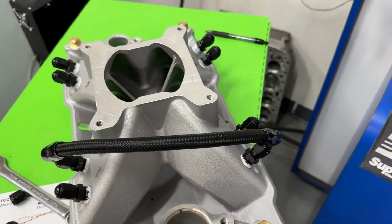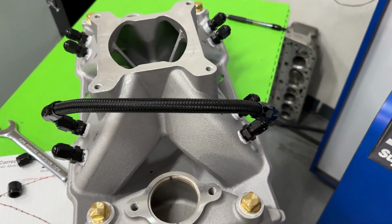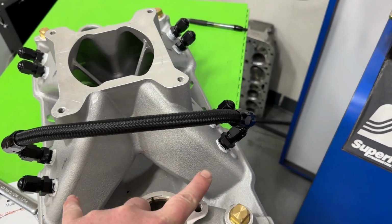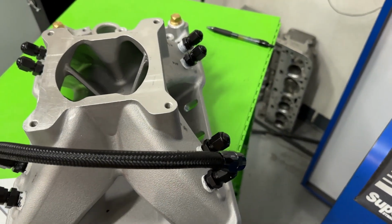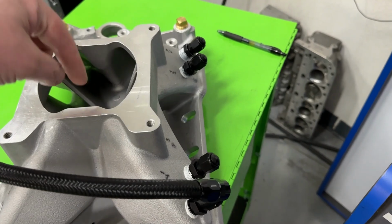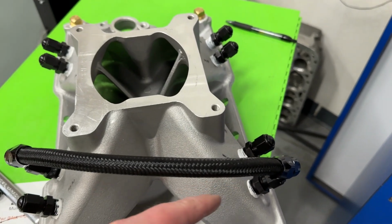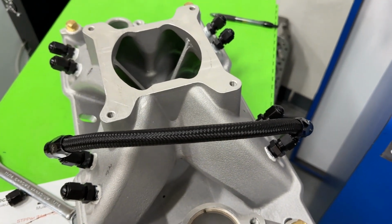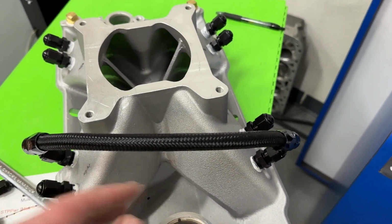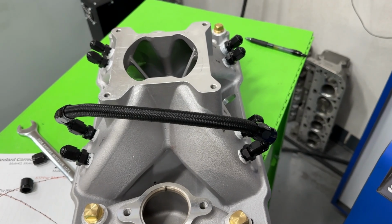But I probably should have thought more about it, because in essence, when we're dealing with all this stuff, it's really just dealing with pressure differentials. At a certain point, they're going to equalize. And that's what this just did. So they only equalize their own. You might be like, well, duh, what's the difference between that doing it in the manifold? Well, my thought was, as a reflection wave comes up in the plenum, it dissipates. So if I could just grab it here, I could transfer it over, like what it still had energy to give to there. I didn't really think all the way through it about the pressures. All it will do is give it slightly more pressure, but they still have to equalize. It just won't work. So it was kind of a letdown, but I wanted to try it.